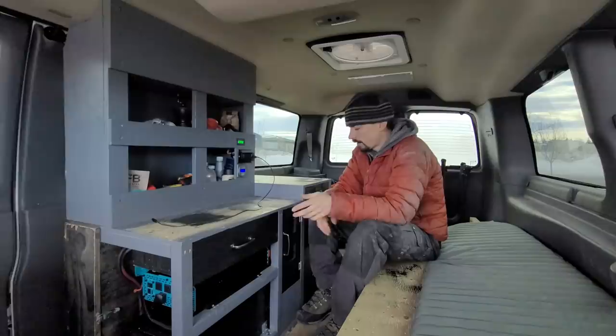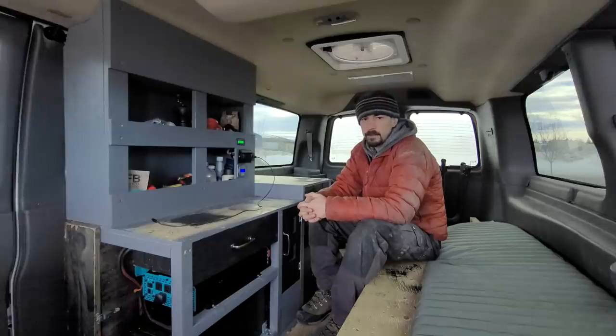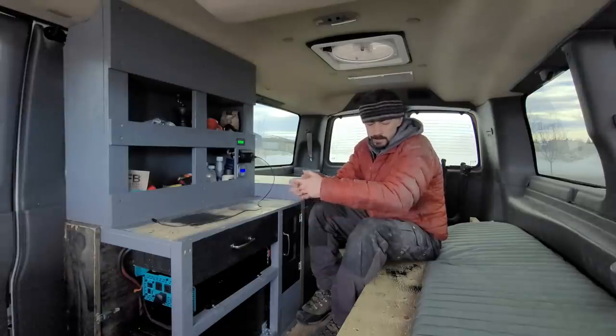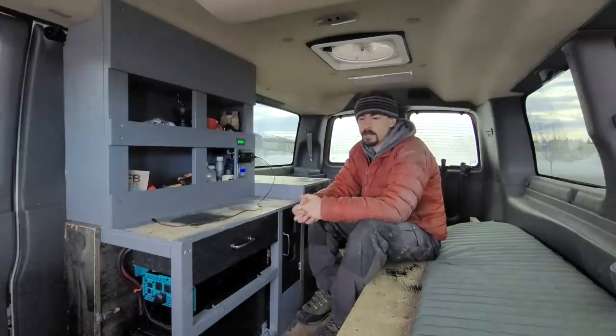But last night in the dark, I just did a rush job and hooked up the fuse panel so it's all wired up. I gotta move on to the alternator install now. I'm already all dirty because I was crawling around underneath the van trying to find the engine block, the chassis ground. I gotta do the big three wiring upgrade, so I'm gonna have to measure out all the wiring I need and head over to Princess Auto and get some 1/0 gauge for that.